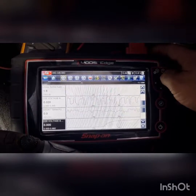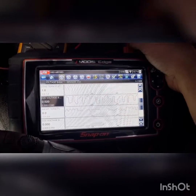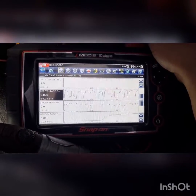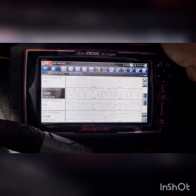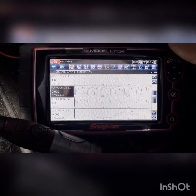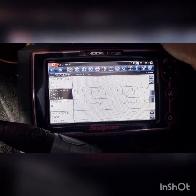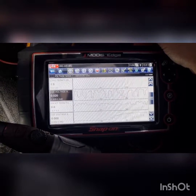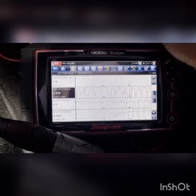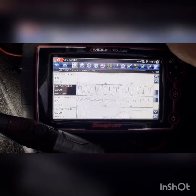It did take a long time for the sensor to come alive — 200 to 300 frames — while the upstream sensor was alive even before we started. It still wasn't alive after a couple of minutes where the front one was nice and active. Not sure if that's the actual code-setting criteria, but either way a new sensor is on its way. This is a nice little lesson about bias voltage — it nearly caught me out, but that's why it's always good to do all our checks and not just assume it needs an O2 sensor as soon as we see an O2 sensor code. Thanks for following us guys, hope you enjoyed it — please consider liking and subscribing, see you in the next one, take care.